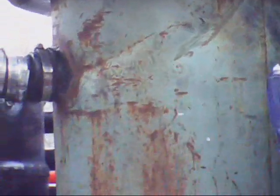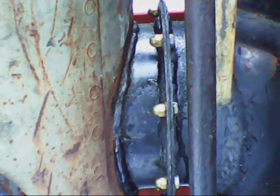The main difference with mine is this heat exchanger. I did originally have the heat exchanger that Wayne shows in his YouTube videos and plans, but I ran into some trouble. When I first made the gasifier, I didn't put mounting bolts from the pipes to the cooling rails or attach the gasifier to the actual bed of the truck. They suggest you do that, because basically this thing will sway back and forth and the only things holding the gasifier are the joint here and the connection at the cooling rails at the top of the heat exchanger.